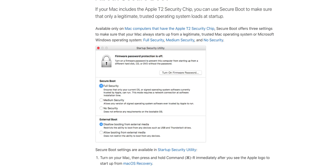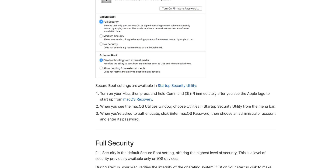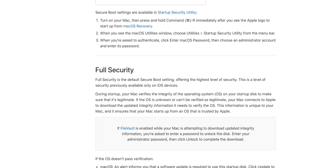Mac OS and the Apple system have really locked down on that with the T2 chip. I googled it and found that I had to make sure my boot security was off, because there is a boot security feature that controls whether your computer will boot from an external drive or not. Mine was on all the way, so I turned it off — set it to absolutely zero boot security — because I wanted it to let me do what I wanted. But I tried it and it would still not boot up, which was really a bummer.